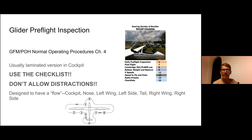Yeah, I also like to turn it on at a lower altitude because I know it's working when I take off. And when I come back after a long cross country, it's nice to get a couple shots of oxygen before you land. And with the EDS system, it uses very little oxygen at low altitudes. It uses a lot more when you're at 17,000. But when you're at 6,000, it's hardly using any.